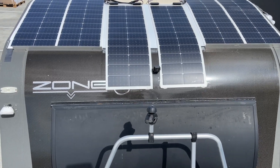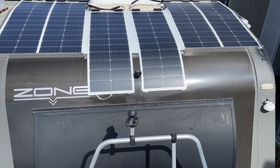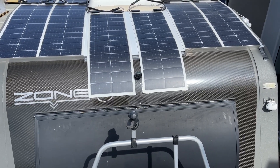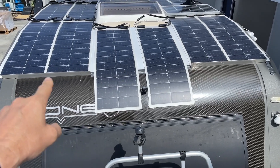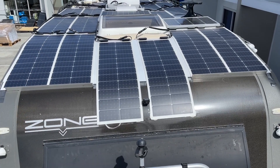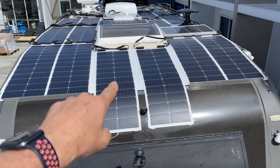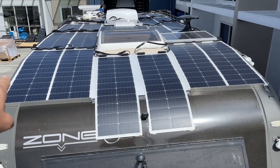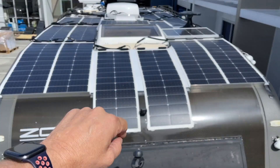Hi, Bruce from Safari. Everyone's familiar with that brand. This is a Summit, and the issue with the Summit is the top of the van has got carbon fiber, which is black. As most of you know, a black roof is death in terms of heat. So what we had to do on this Summit was put white core flute all the way across to get insulation in there.